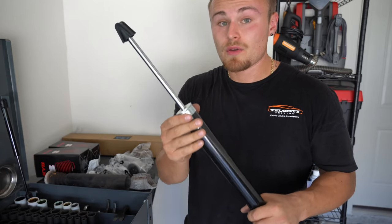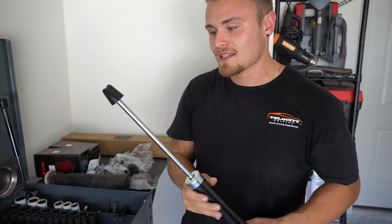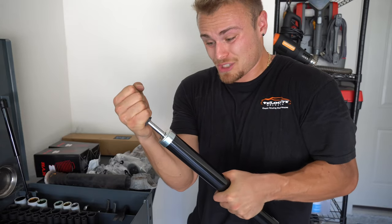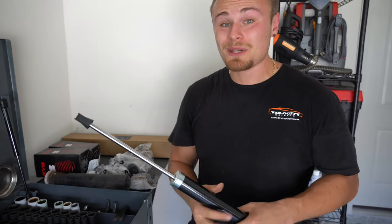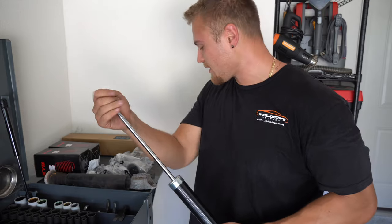So this is how we know this will take a lot more of that impact instead of my tires, especially how cheap this is. But this is one way you can tell you have a bad strut compared to a new one. 170K miles, it's a bit too much. They usually only last 50 to maybe, let's say, a solid 100K miles, but good thing we're replacing this.